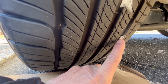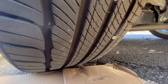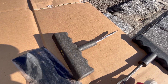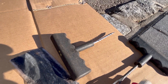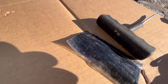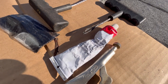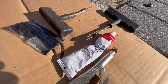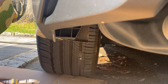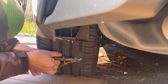We're gonna pull this out — all the air is pretty much gonna leak out. We're gonna use this tool to go in and out and make the hole symmetrically round, then stuff this plug in with a little cement and shove it in there. Hopefully it'll work. First thing we're gonna do is rip it out, and all the air is gonna come out — that's okay, I got an air compressor.